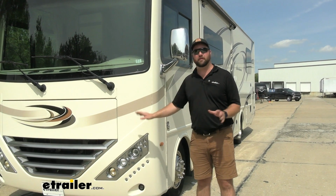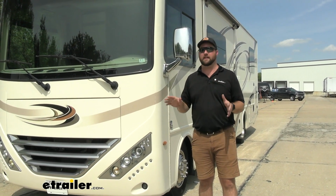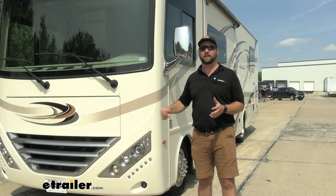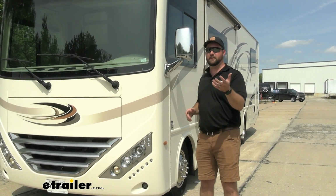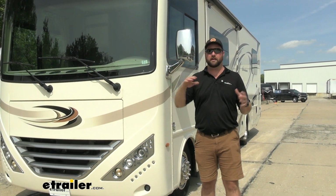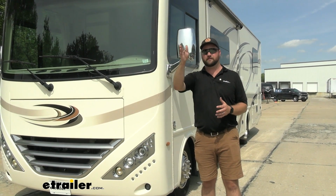I had these wheels perfectly centered, or so I thought, and I went on the test course, and I was not happy with how it was steering. It was steering slightly to the right, so I went back underneath. I had my videographer, Tom, actually straighten out the wheels while I looked from far away, took another measurement, put it back on, and now it steers straight as an arrow.